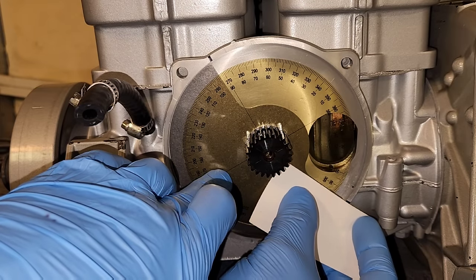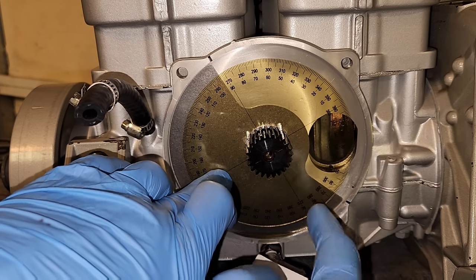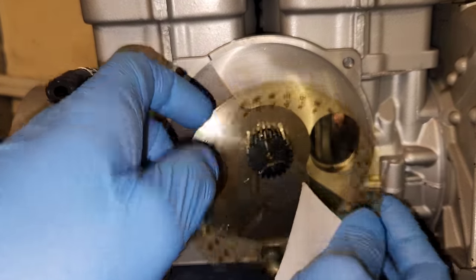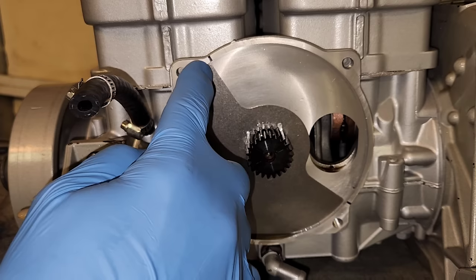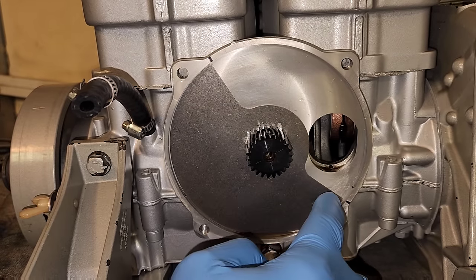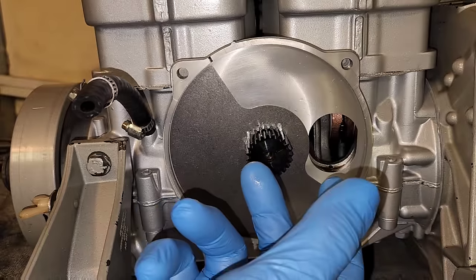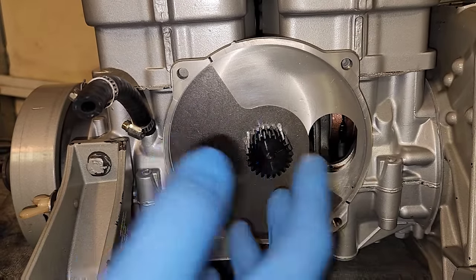And you line that up — you see 60 and then you go to five, 65.5 — you get the mark right there. So if you're looking at the valve and you take this back off after you get the timing marks set up and see the valve itself, if it's lined up as close as it can be, that's great. If for some reason it's off a little bit, you can actually flip the valve around because it is asymmetrical and get the best lineup.